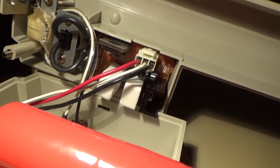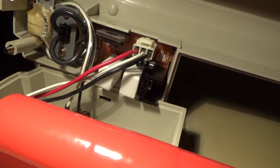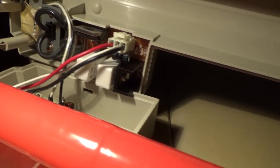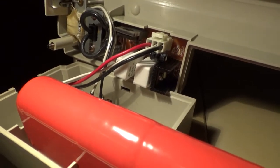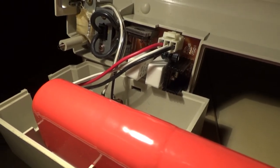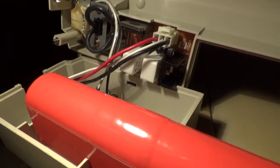And this is inside the battery pack. That is the charging circuit right there. It's a very simple charging circuit, and we'll get to why it's very simple in a minute, but that should mean we could just charge this without having it plugged in the laptop, which would be useful in its military applications, I guess, because you'd be able to have batteries charging and use the laptop somewhere else if you had a spare power cube or extra batteries.